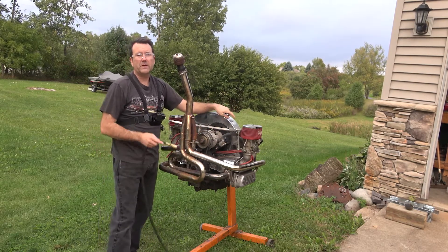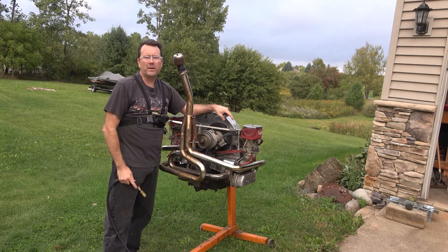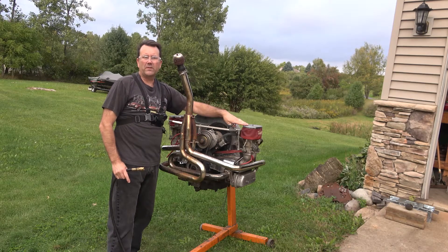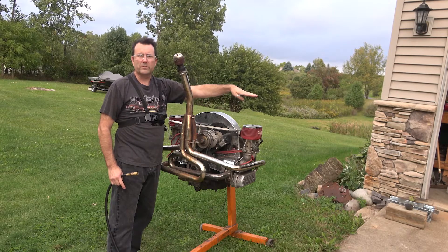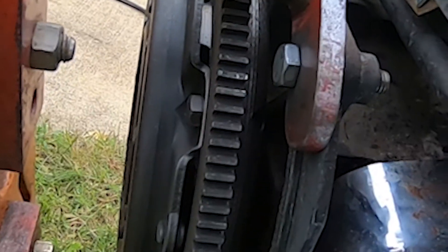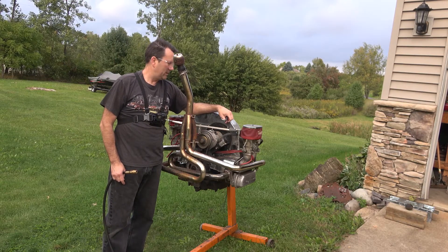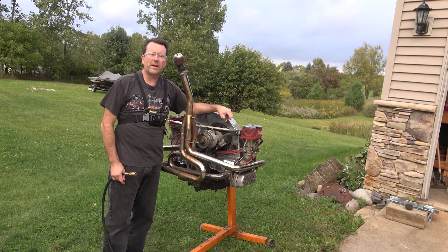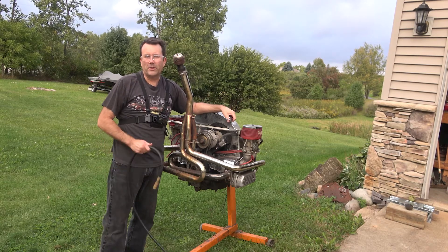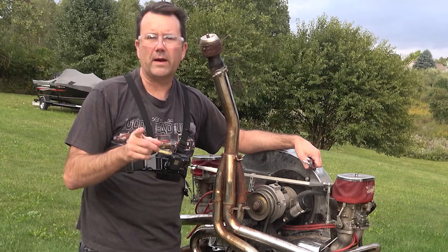It's got 48 millimeter IDFs — yes, I said that correctly, 48 millimeter IDFs. When I built Brian's and his friend's engine they actually offered these 48 millimeter IDFs brand new at the time. They didn't want to cough up the extra money for the IDAs, and the IDFs do fit more compact — IDAs with an air cleaner would stick way up. It's got a really really lightweight flywheel, probably 8 or 10 pounds, which means this engine revs up really quickly. When I get going tearing it down we'll know for sure what it actually is. Better get the cameras and the engine in before we get too much more rain. As always, keep shifting those gears, keep cruising, and always enjoy the ride — we'll catch you guys later.